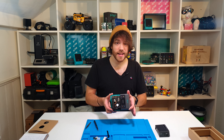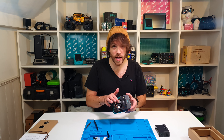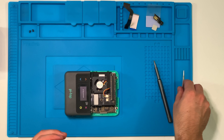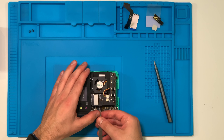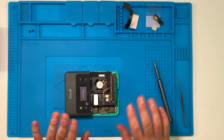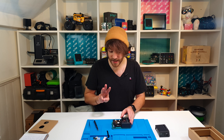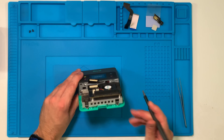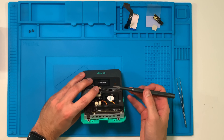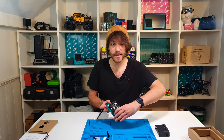This is your first glimpse inside the Pi Top. The first thing we're going to do is gently pry away the silver connector you see here — you can do that with your fingernails or with blunt nose tweezers. Just get under there very gently; it shouldn't take much force, so don't force it. Once you've done that, there are three screws to remove: the two black screws visible here, and a small silver screw hidden underneath the connector you just removed.